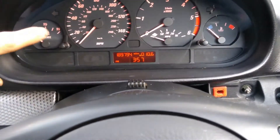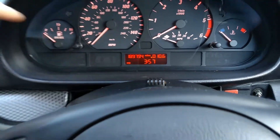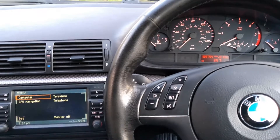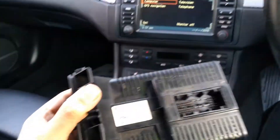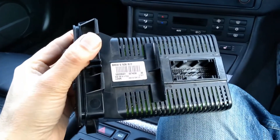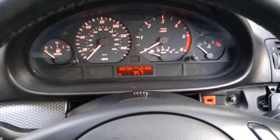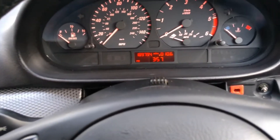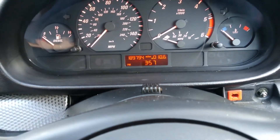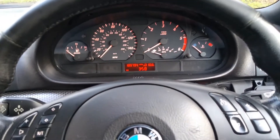True enough, if you haven't reprogrammed it and you put a second-hand unit in, you do get this dot appear by the S on miles — they call that a tamper dot. The reason it appears is because the mileage for the car, as well as being stored on the instrument panel and some other locations, is also stored in this unit. If you replace it and don't program it, there's a different mileage stored in there, probably a different VIN number as well, and the car thinks the mileage has been tampered with — hence that tamper dot. I'd rather it wasn't there, but it doesn't bother me that much. And I'm guessing if you're watching this video because you've got all sorts of issues with your car and just want to fix it as cheaply and easily as possible, it's probably not going to bother you either.